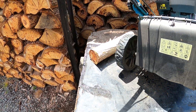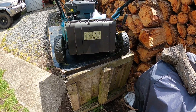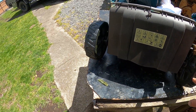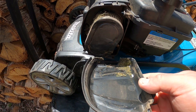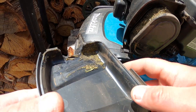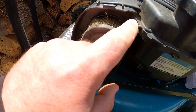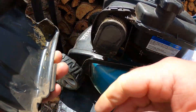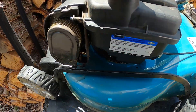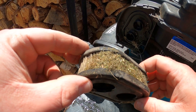Now what I need to do is turn the mower around and have a look in here, because the customer told me it wasn't running very good. Bloody hell, look at this stuff that's in here! So what I'll do — look at this, we're going to have to look at this filter. Look at this stupid idea — it's got an overflow out the petrol tank that goes into the air filter. Who would design something like that? That's a reason not to start an engine on the key for a lawnmower.